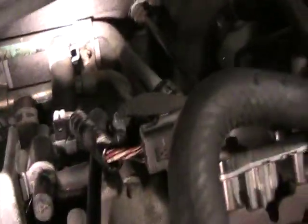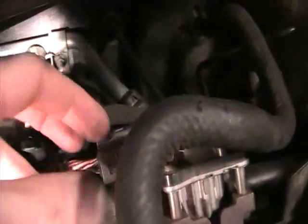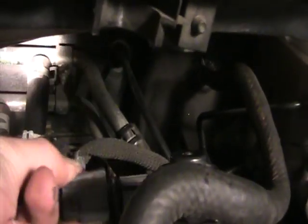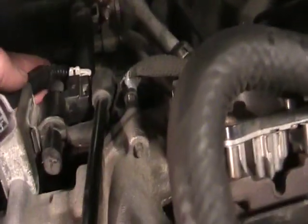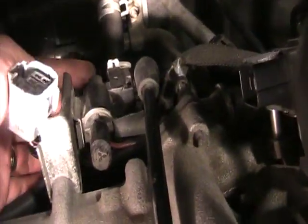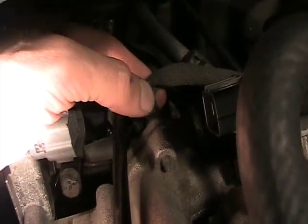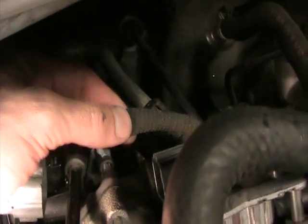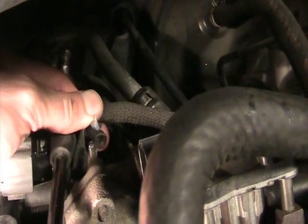It's pretty straightforward. You might want to get this wire out of the way. This is your EGR valve here, and I'd suggest pulling it out firmly and pulling this plug out, then putting it to the side. On the IAC valve there is a cable wire harness going into it — it's a plastic clip-on thing. You need to pull this back and remove it, then tuck it down. This goes to the connector of the IAC valve.